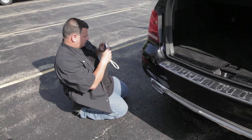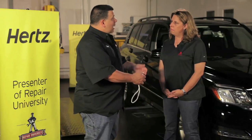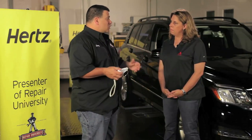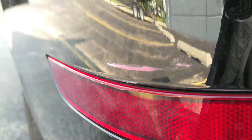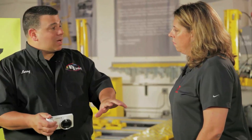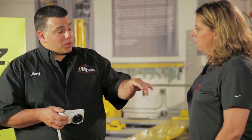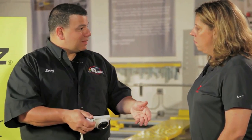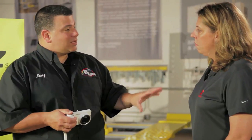Don't take only a close-up of the damage — take it from a little further back first, then come in closer. If there are scratches or deformities that need a close-up, go to macro or get within 9 to 12 inches. After the bumper cover, move to the headlight, open the hood and photograph the backside of the headlight while it's still attached, then repeat after removal. It's all about following and telling the story.